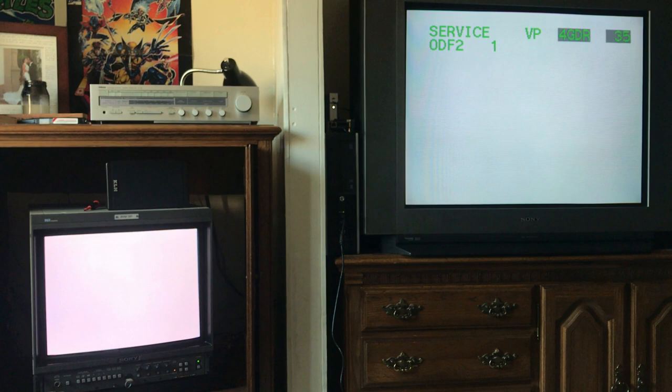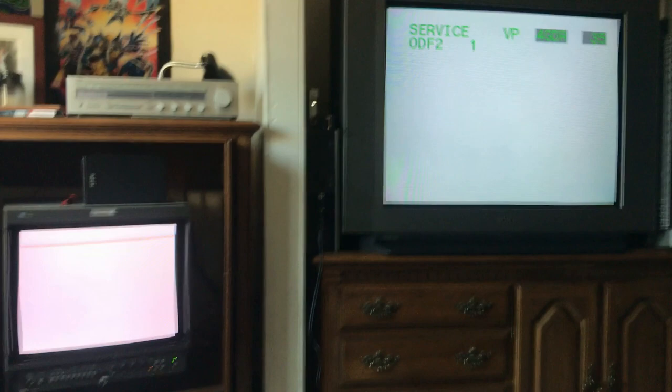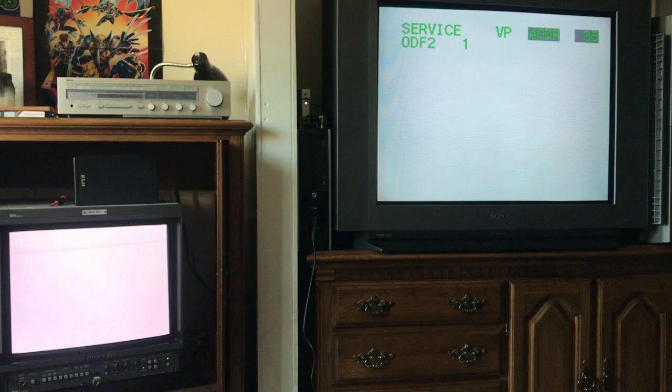After you've done the low end — adjusting the cuts with picture and brightness down — you turn the picture and brightness up (the manual says to max, but I've found that's not exactly what you want) and then you adjust G drive and B drive until you get a white screen. Instead of an oscilloscope, we're just going to compare to my two reference CRTs, which are in very good shape. You can also use an LCD — they typically have great white balance.